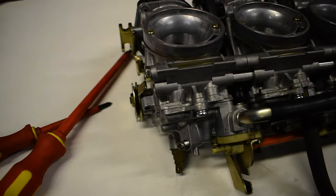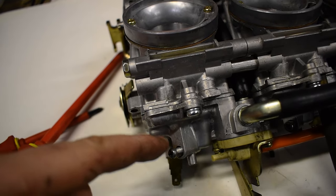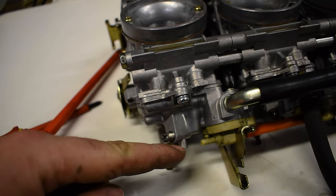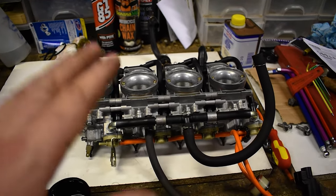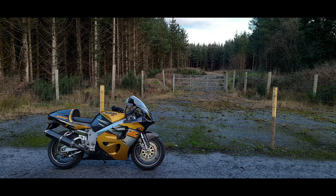If you want to drain carbs, generally at the bottom of your float bowl you'll have something like this - it might not look exactly like this, but it's just a little screw which opens off the outlet for the fuel, and then your fuel comes out there. There's going to be a bit of work in stripping all these down, so I'm going to strip it down and probably speed it up for you. If you want to see the carbs coming apart, being cleaned, or going back together and back in the bike, I will link those videos in the description - they're also in my Gixxer 750 playlist.